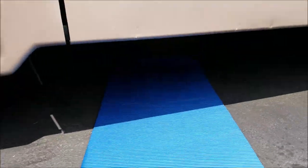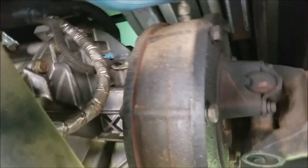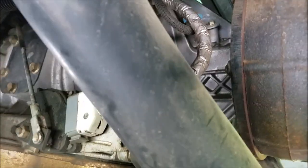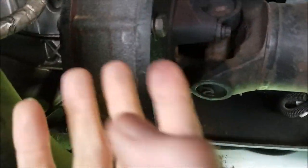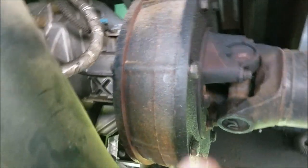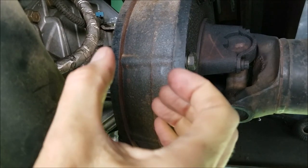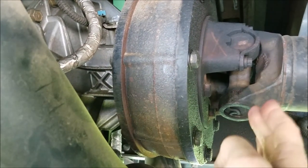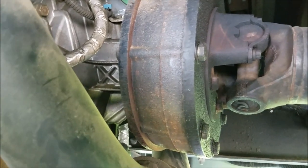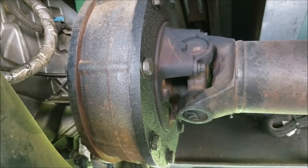There it is — that's your J72 brake mechanism. This part here is stationary, bolted to the back of the transmission. The driveshaft goes through it. There are splines in there and these big spinning discs, kind of like a clutch on a car. A big spring in here is always applied by default — it keeps that brake disc compressed, which won't allow the driveshaft to rotate and won't allow the RV to move. It stays compressed; you're not going anywhere.